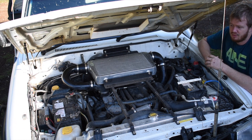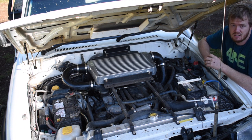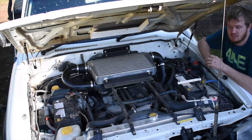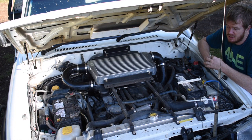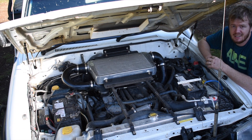Temperatures towing with this thing — EGTs get to maybe 500 maximum. Water temp, with the car trailer on the back, gets up around the high 90s. But by itself, it usually sits at about 77 on the highway doing 100. I could probably get it up around 88 sometimes up a hill. With EGTs going up a hill just as it is, high 400s max.